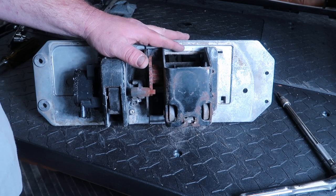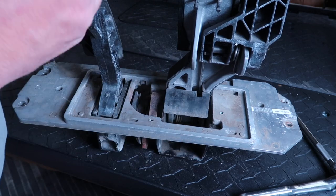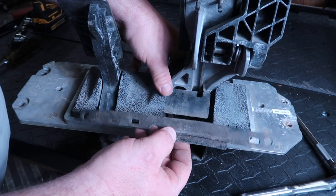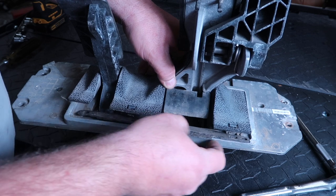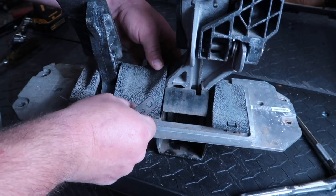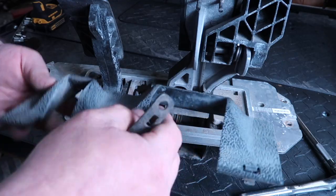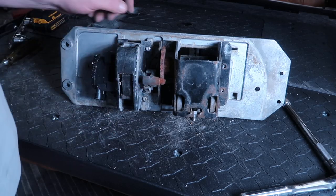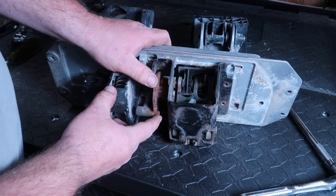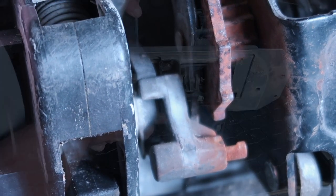In order to remove the two plugs on the M-core from the pedal group, you can use your finger, slide it in here and push away, or you can use a flat head screwdriver if your fingers aren't strong enough. So we went ahead and removed the pedal group away from the golf cart. Next, once the pedal group is removed, you need to go ahead and remove this cover here. This long piece goes up underneath the cover and is popped into place with tabs — just take a flat head screwdriver, lift in here, lift up, and once you get it up it will come out. Now we need to replace this pin right here. This pin is not catching — it's not latching every time you go to hit the parking brake. This pin is worn out and we need to go ahead and replace it. See how worn out it is — it's notched out there.